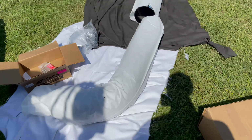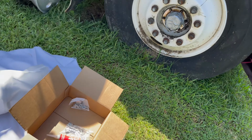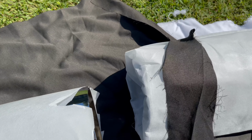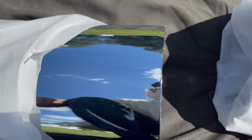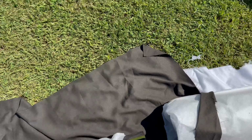They got the stacks out here. I had to run to the store and get some high temp silicone right here. And we gonna bead this around the bevel part right here. I'm trying to pull it off with one hand. This side is bevel, so it's gonna slide down in the inside of here. So what we're gonna do is take some of this red silicone and just go around the outside of this. I ain't gonna put a lot, just one little bead all the way around. I'm gonna slide it in there. I mean, they good and tight, but you know, never hurt to have a little bit of insurance on it. But these leaking chrome stacks, as you can see.